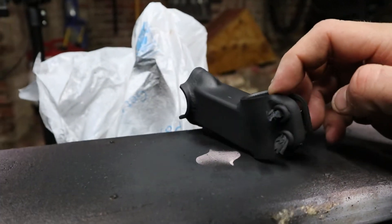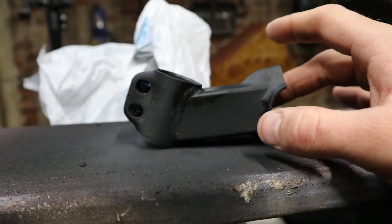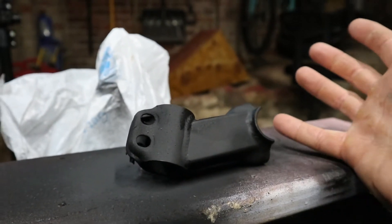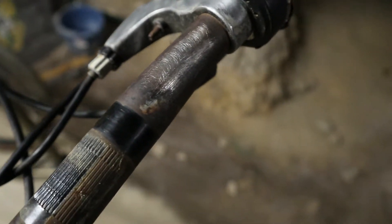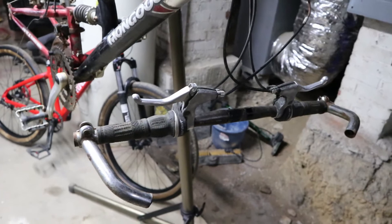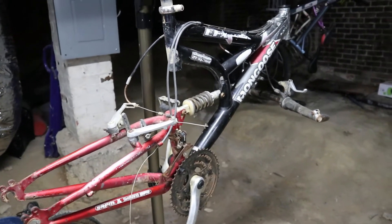This stem was pretty rusty and the handlebars were very, very rusty. I brushed off the surface rust but it didn't really seem to do much, so I threw some quick matte black paint on the parts. This paint is really durable enamel, so I'm not too worried about it. The handlebars are time-consuming to clean, so since all the cables are coming off anyway, I'll pull the bars off, throw a quick coat on them, and then they'll be good to go. After that, let's get to cleaning the frame — that'll be step one.